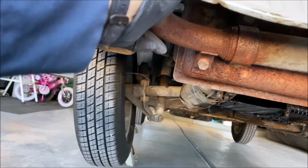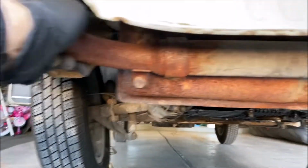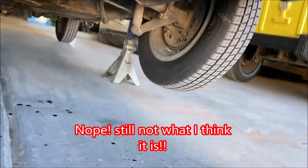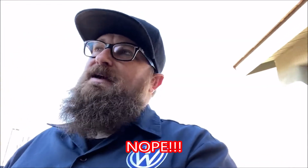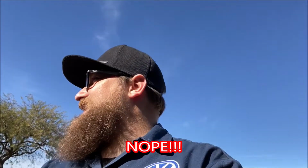You can kind of help find exhaust leaks, honestly, by plugging off the exhaust. But everything's actually still pretty tight, except for that back heater box on the side. I don't know, I feel like we're still in the exact same spot. At least we know where the exhaust leak is from. Although that looks like it would be a colossal pain to do that exhaust gasket in the car.